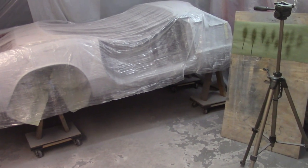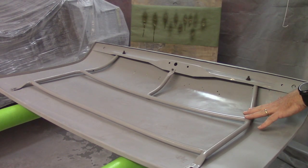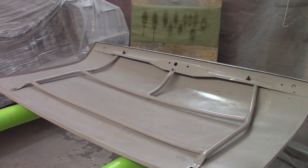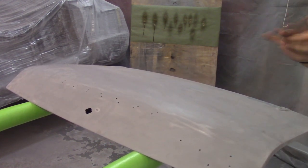All this tarp is going to come down, everything's going to get mopped and cleaned again, so I need to make sure there are no more dust-making evolutions yet to do. I do need another round of epoxy on the inside in here — if for nothing else, to get these bolts — and it also needs to get blocked and sanded in here, it's not very smooth. The outside, however, is pretty good. So still some more work to do.